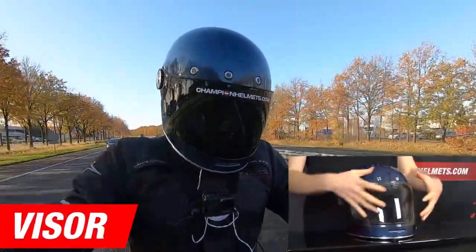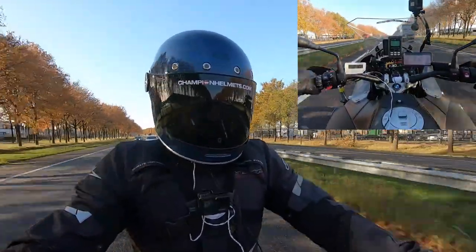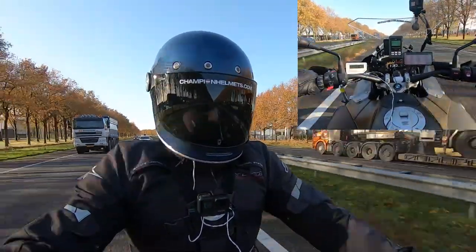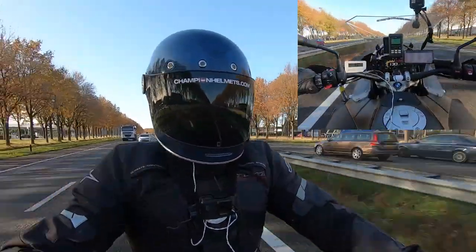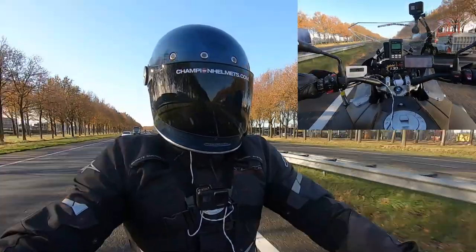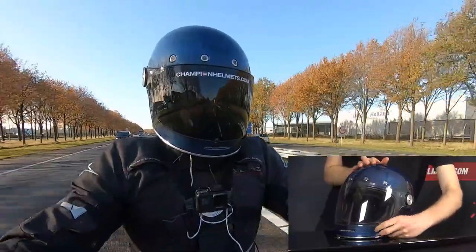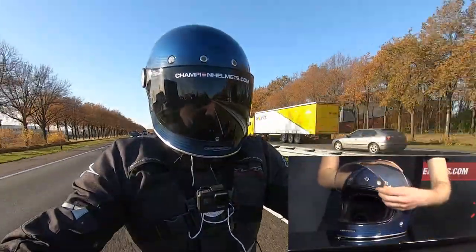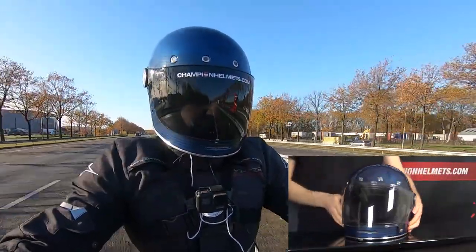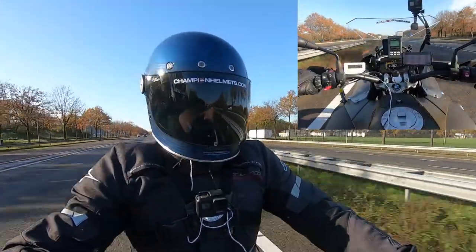The visor of the Bell Bullet comes with that classic large, round shape, with some versions even being offered with a bubble shield. One pro of this large flat visor is an excellent field of view, but the con is that it is not Pinlock-prepared and is only anti-fog treated. Bell does provide an extra dark smoke shield in the box, which is a nice extra. For fastening, you get the Magnafusion closure system — a magnetic strap that lets you close the visor securely and open it easily. Note that the Bullet only allows the visor to open to a fully open position or halfway.